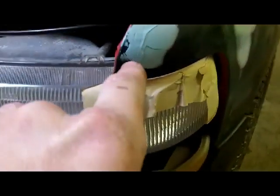All right, guys. First clip was getting all the overspray off of these. I took some 320 and blocked out by hand along these areas to make sure there was no messed up spots, even up here. And we knew there was a low spot in here, and there was a high spot here that I tapped in. That's got a wipe of glaze on it. Actually, second wipe of glaze, because it didn't come out on the first. There was a little boink there that's got some on it.